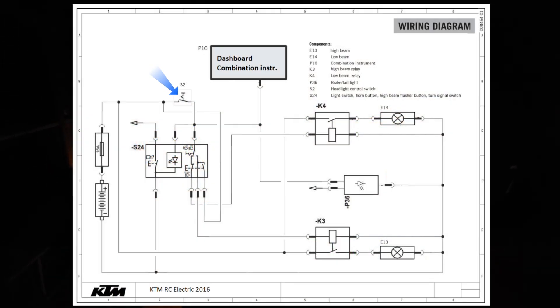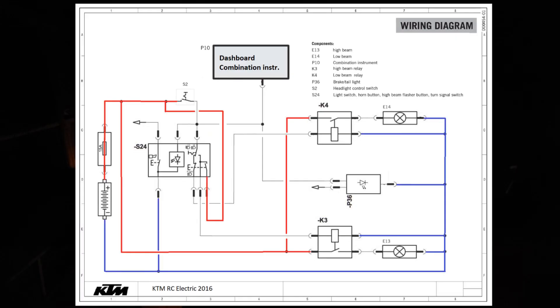The headlight is excellent, and now we will analyze the connection diagram. It includes the main headlight switch, left light switch controller, low/high beam switch, the button for blinking the high beam, and the signal button. You can see where connections go to another sheet of the circuit. The LED provides backlight for the light switch controller. Now I will show you how the current flows when the main light switch is turned on.